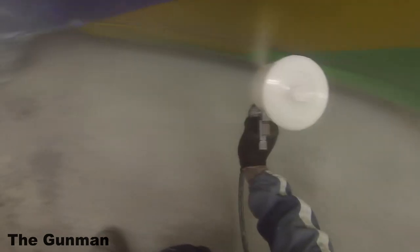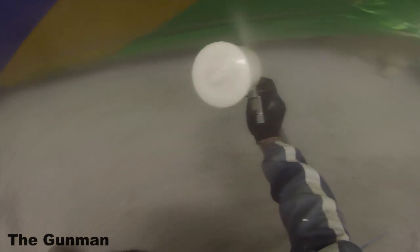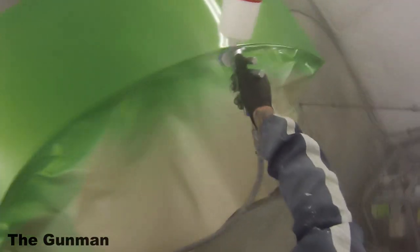So on to the next question is by Stress Test. After shooting base coat, how long can you leave it before you put your clear coat or another coat of base coat on? I've always been told 24 hours is the recommended window. So if you leave it any longer than 24 hours, you probably really should give it a scuff back, say with a 800 soft pad or something like that. Put another coat of base coat over it and then get your clear coat on as soon as it's flashed off. I'm sure all that info is in the technical data sheets, but hey, who reads them?